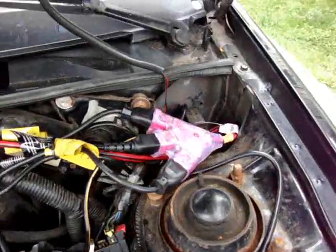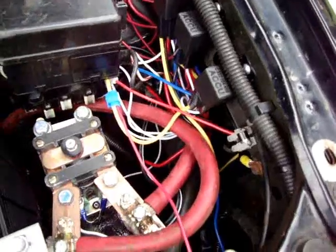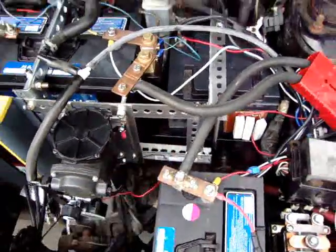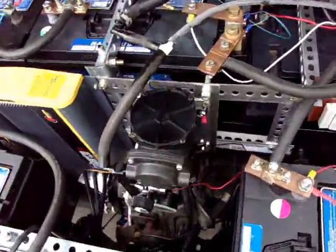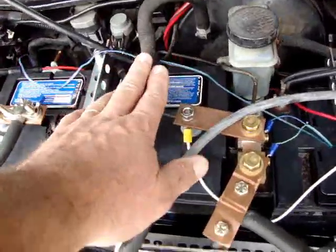Got a Triplex plug up here for the chargers. I have a small 12-volt charger buried down in this corner which will come out next week. My DC to DC converter, which will end up in this area here, is coming Monday or Tuesday — that will eliminate that charger. Everything will be mounted up here. This is the Thomas vacuum pump which runs the brake booster.